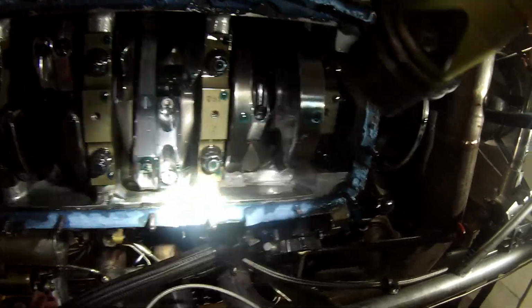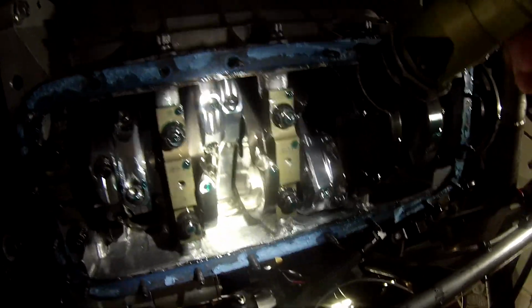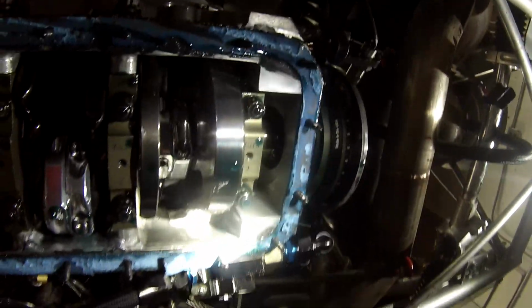Before we go over here, we torque these rods. Then we go over here, do the same thing, go through everything, torque these 2 rods, and then come back through. Once I've gone through and done all 8 here, then I just double check, and I start at 8 again, and I work my way back, and I just recheck the rod torque.